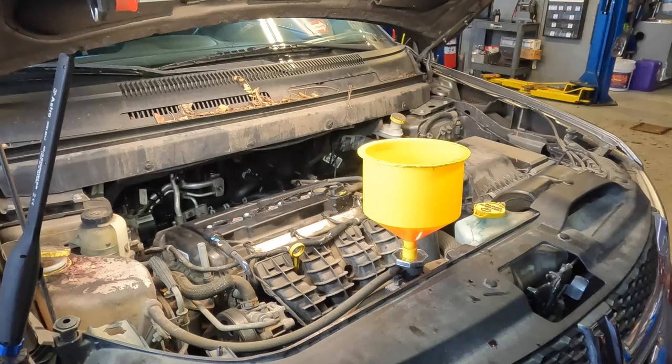If you don't do this step and leave it on AC mode or don't check, if you have an air bubble inside of your heater core, it won't make itself apparent until winter rolls by and you turn on your heater and your car starts overheating. Sometimes you'll hear a waterfall noise inside your dashboard or circulating throughout the car. So don't skip this step — sometimes it could take until wintertime for it to show up, sometimes it shows up right away. The air pocket will get loose and ruin your day; you'll be stranded somewhere with an overheating car. So I'm definitely going to go ahead and do that. Now I'm going to take you inside the car and show you guys what I'm referring to.